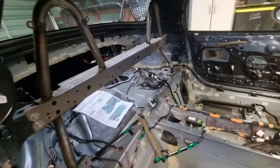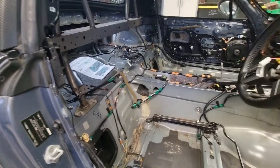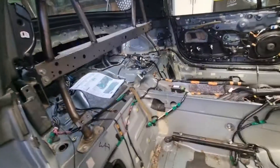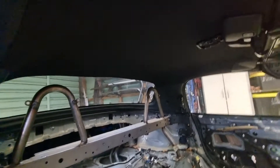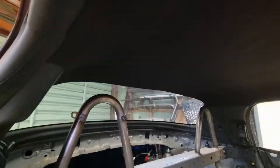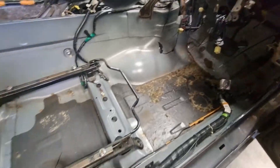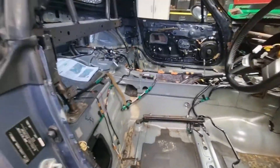I don't really fit in these cars. The particular owner of this car is not too tall, so that's excellent. We may have to end up doing something fancy with the seats — the factory mounting points are a little bit high, and hence any aftermarket motorsport-related seats we're going to be putting in get pretty close to the roof. The roof is removable, but he wants to retain that, so they've got rid of the folding mechanism and it's just a hard top roof. We're going to have to work out a way of squeezing a cage in here, tuck it up nicely along the roof line and down the pillars.